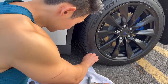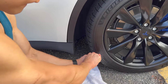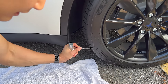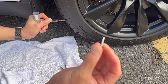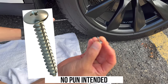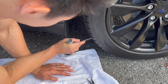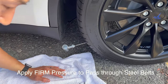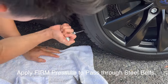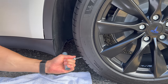So that's it. That is the nail that was in my tire. It's a pretty small nail, which is probably why the air didn't leak out as quickly. And if you have a screw — like spiral screws — then you're really screwed. So now I have to get over here and I just push it in. I've never done this before. I don't know if I'm supposed to go in all the way, but I'm twisting. I think they made it like this so you can twist it — just kind of twist back and forth. Okay, so now that's in.